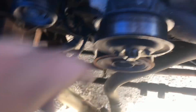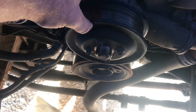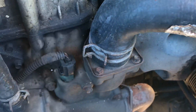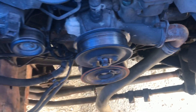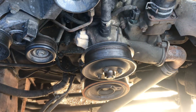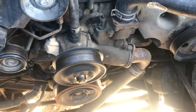On the ground here behind me I've got the new water pump. I've got to get the pulley assembly off and get the old water pump off. There's an adapter neck there that'll come off and go back on. I've got the new fan ordered. I think the clutch assembly and the fan itself is fine, but I had to get a new fan because it's all busted up. I'm going to keep tinkering — the next step should be to pull off the water pump itself. I'm going to look at the new water pump to see what all is connected to it.